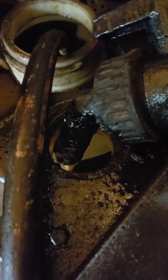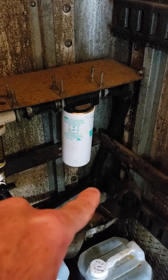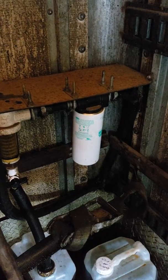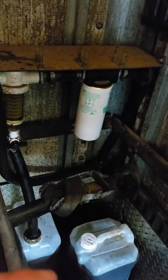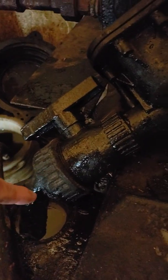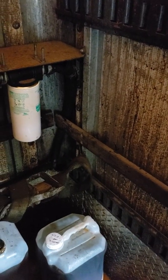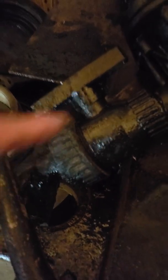I'm going to go outside. I'll leave this valve open because it's in the T over there — the other hose goes outside to my tank on the truck. I'll take that hose out and stick it in the fuel tank outside. When I go outside and get the fuel hose hooked up to the tank and open that valve, it'll take that path instead of going back into the storage tank — it'll go out and fill the fuel tank on the truck. If it wasn't set up that way, the pump would build up so much pressure it would blow a hose, like it did a long time ago.